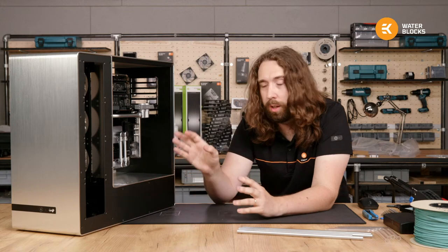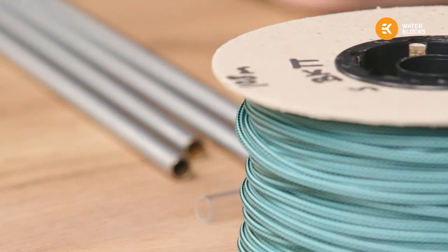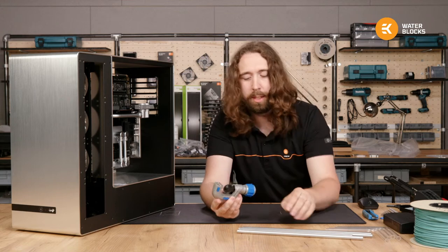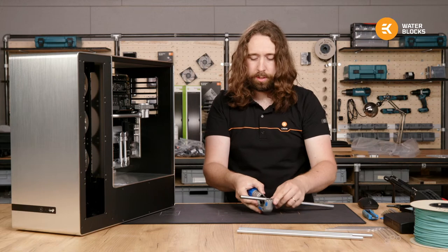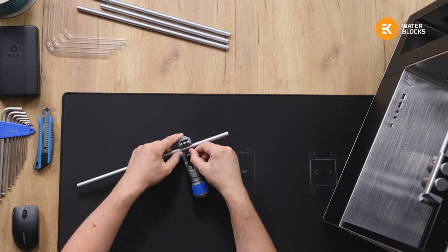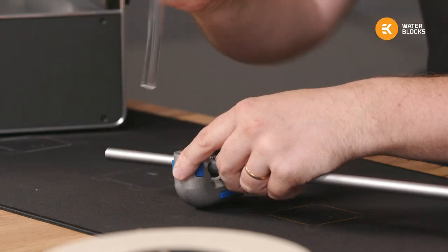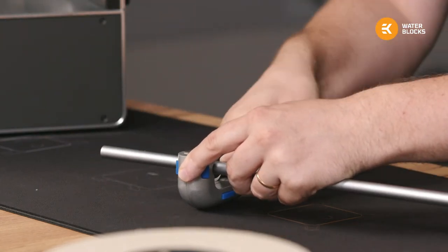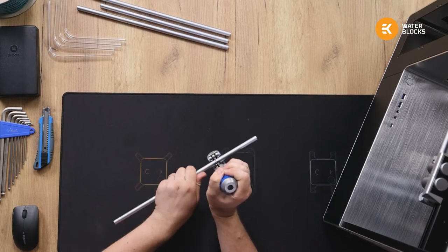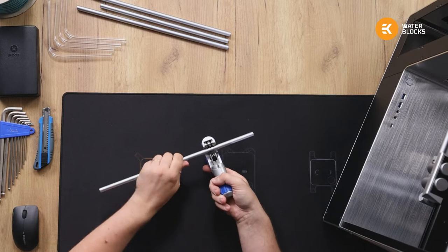Nothing went too surprisingly difficult with the tubing. I wanted to show you on camera what tooling I was using. So this is the tube cutter that I was using, which has roller bearings and a super sharp blade. I can demo it for you on a piece of tubing. So the tube goes into the rollers, and then you just very carefully line up where the blade's going to come. If you've made a tiny mark, or you can offer up what you're trying to duplicate if you've already made it in plexi, and check that it's right, then tighten it up, and you can see that it starts to score the tubing. After a few spins, spinning again, it actually starts to cut surprisingly fast.